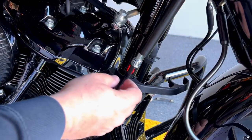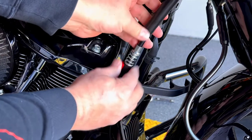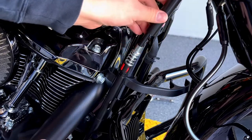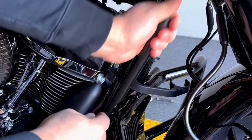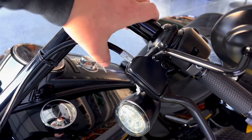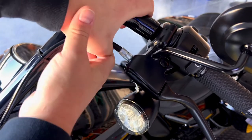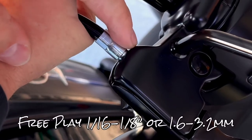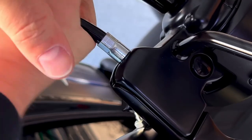Now that you've adjusted the clutch at the hub, release this pin to remove the slack, and push it back in. Cover it up. Now that the slack at the spring is removed, pull on the cable and make sure you have proper free play at the lever — about a quarter inch feels about right, so that's good.